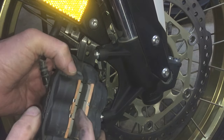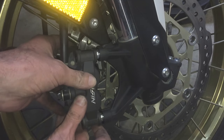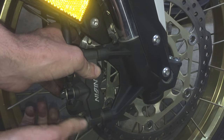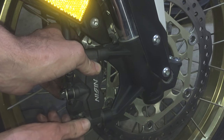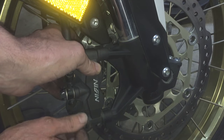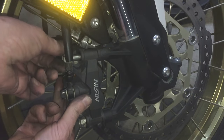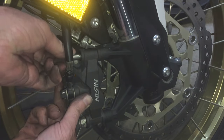With the pads in place and the pistons pushed right back there's plenty of room to slide it back onto the disc. While you're watching me put these bolts back in, let me explain that I'm not trying to tell you or show you how to do it — I'm just showing you what I've done. Of course you should take your bike to an authorized Honda dealer. Sadly I'm one of those weird people who would rather do it myself and know that the job's done properly, but if something fails I've only got myself to blame. Taking responsibility for your own actions seems to be a very weird thing to do nowadays — but maybe I'm just old-fashioned.